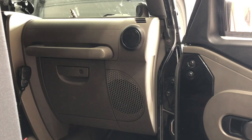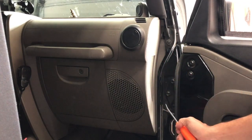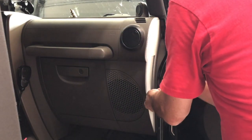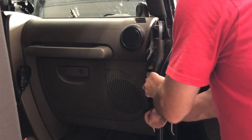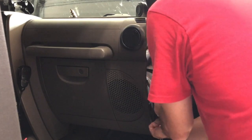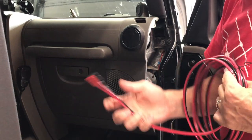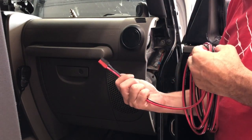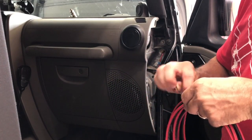Now that we've got the antenna run around, we need to get the power cable run back out to the battery. I've got one power cable already in here that runs to the 857, but we're pulling a new one for the FTM 400. Something really cool about a Jeep — right behind this is an access port through the firewall, a real nice place to run cables. I put power poles on one end of the cable; the first thing I did when I pulled the radio out of the box was cut that factory power cable off and put power poles on it. We power pole everything here — makes life so much simpler.